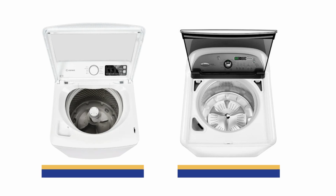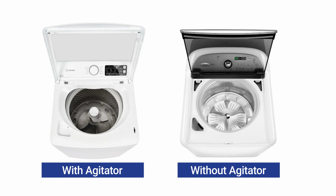Now, if there's one piece of advice, there's one thing that I'm going to give a C, D, or F to, it's the ones without an agitator. Exactly. To me, the agitator is what moves the clothes and moves the detergent and everything else. Not having it, I'm just at a loss for how that actually gets done. Yeah, and we've tested that out, multiple brands, multiple different times, and you still need to load the clothes as if the agitator was there, and they just don't get a lot of water and a lot of turn, and you really need clothes to turn in the detergent to really get them clean. And without that agitator, it's really difficult to do that. So really, when we sell top load, we're selling primarily ones with the agitator.